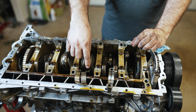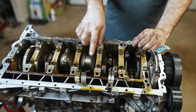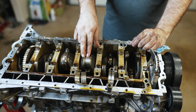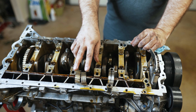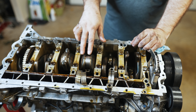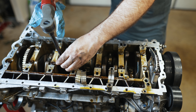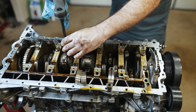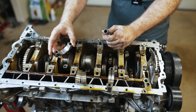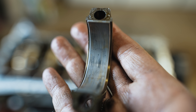So this number four is right up at the top here — we'll check it. Number four is the hottest cylinder actually, so if this is in good shape then we know that it was just a detonation issue or cold oil, pushing the car too hard. These aren't completely toast — that's why I didn't find anything in the oil. Number four: not pretty but not shot. It took some abuse but it didn't spin. It's not terrible actually.